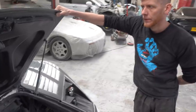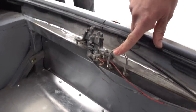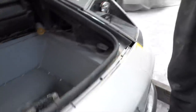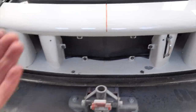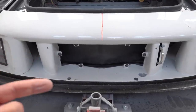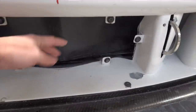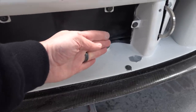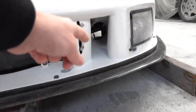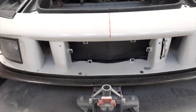Which could be pretty dangerous at 200 miles an hour. On the front end here you've got the bonnet catch sorted, but there's a flat plate at the front because there's no oil cooler going here. I didn't just want a flat plate, so we've used the standard LP640 nose cone and modified it — it comes to a point and allows the air to travel down the sides in the same direction as the vents. Hopefully aerodynamically it won't be like a brick wall and won't send air where it shouldn't be.